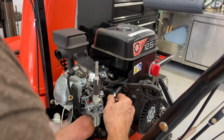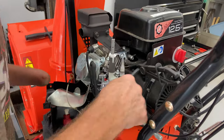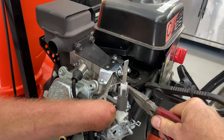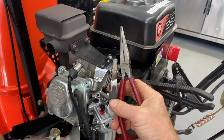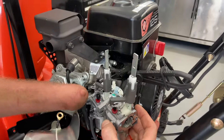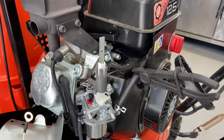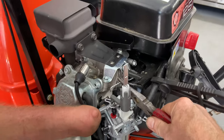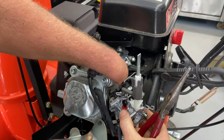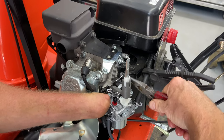We're going to go ahead and put the fuel line on the carburetor now — put your clamp back on. At this point I'm going to pick up the throttle. This is spring-loaded so we have to move this back. It looks like our new carburetor is a little different than the old one. The old carburetor had a clip; the new carburetor has a slot in it. That slot is going to allow us to put the governor arm linkage in. I'm going to pull the carburetor out a little bit to get it to go in — just like that. See how it's locked in now?